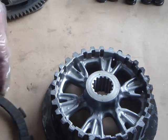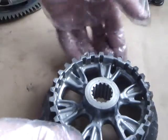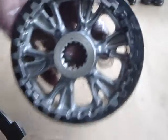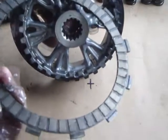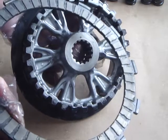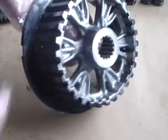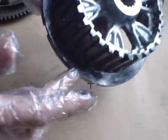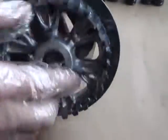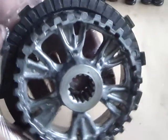Here is the hub from the same engine. We've just seen how bad a condition the clutch cage was in. This is the hub. Some of the still pictures I showed earlier on showed this hub having been taken out of the main clutch assembly. This is the gummed up clutch plate — completely polluted with its own worn-off friction material. You can see it's just made a horrible black paste that has coated the face here. That was the friction lining that ran against the aluminium of the hub.